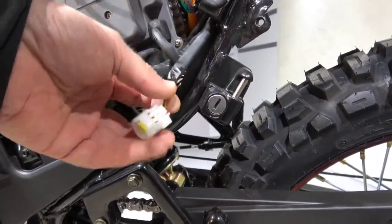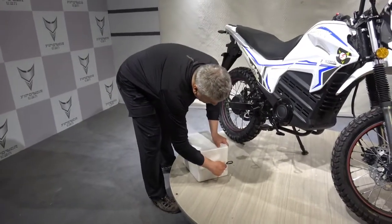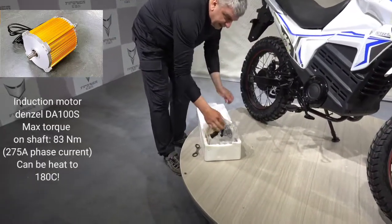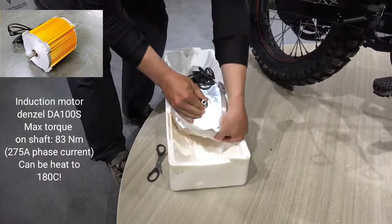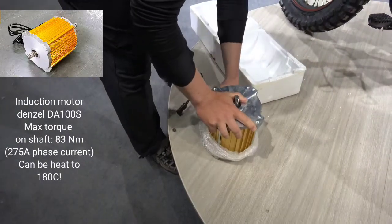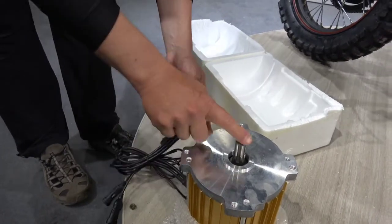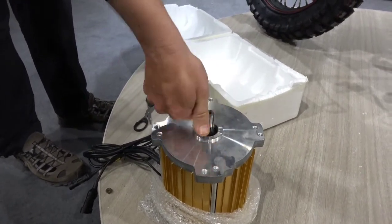After speaking of the motorcycle's brain, let's talk about the heart of it — its engine. We are the first in the world to produce asynchronous motors in series and put them in the Liberty electric motorcycles. This type of motor doesn't have magnets at all. Such an asynchronous motor can be heated up to 180 degrees Celsius. The engine has a huge driving torque: on the motor shaft, the maximum level is 83 newton-meters when the phase current is 275 amperes. This is a new kind of asynchronous motor, developed by a German company ACCP using combined winding technology, produced in cooperation with Denzel company. Unlike engines with magnets, the asynchronous one doesn't have magnet sticking, and this becomes an advantage for free coasting of the motorcycle — as easy as if it were a bicycle.